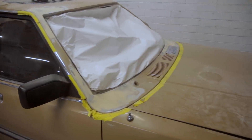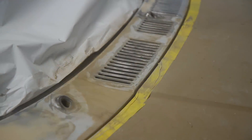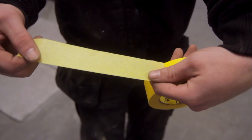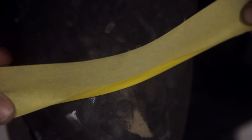Now the job in depth, and here are those grills again. This is the point where I'm pulling the original paint out with the knotted wire wheel. Now it's time to learn a little bit about masking, and what Gary is going to show us here is a trick they use to make sure they don't have a hard edge at the edge of a newly sprayed section of bodywork. What he's doing is folding over a small section of the masking tape.